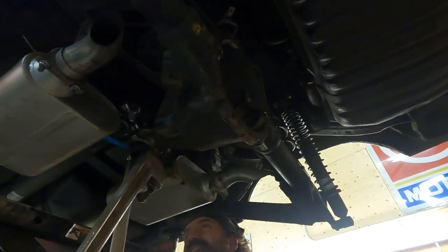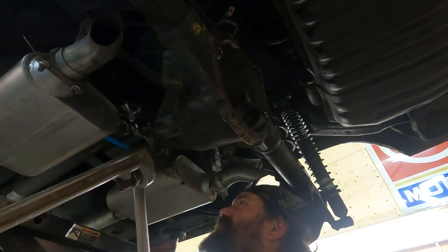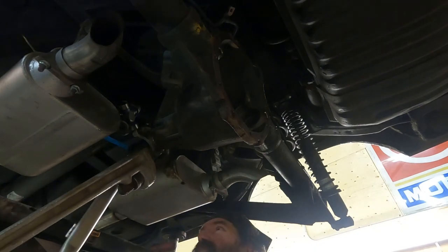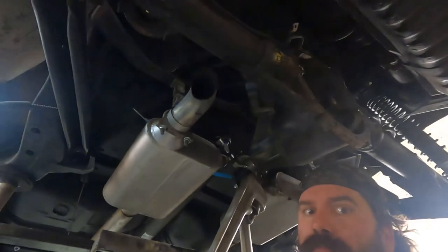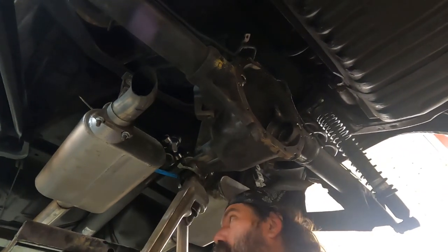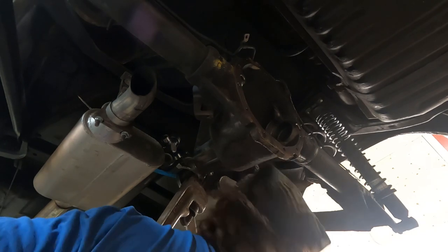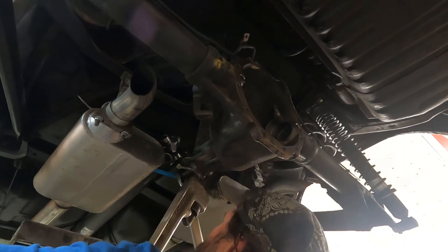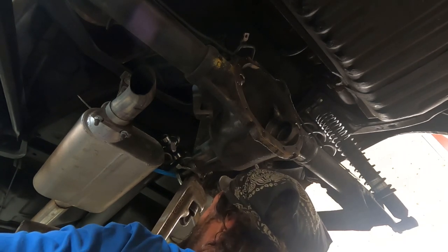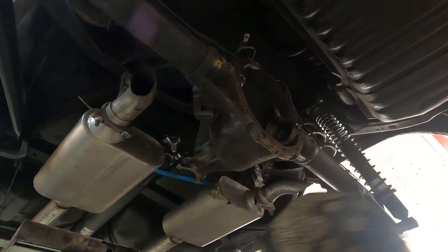Well, this is kind of awkward. I'm trying to hold the pinion yoke with a pipe wrench. Put 125 foot-pounds on the nut with a torque wrench. I've slipped a couple times already. Punched myself in the chest pretty good. Got her.